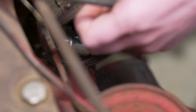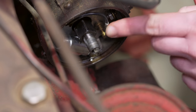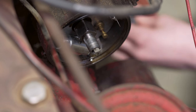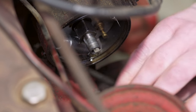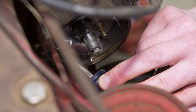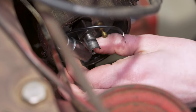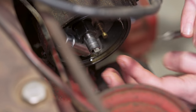The next piece to remove is the condenser. See how that wire wraps around there — that wire was held on the same tab as the points were, so you can just lift that off. Then there's a little strap that goes around the condenser and you're just going to use your screwdriver to pull that out. Mine has a regular screwdriver slot here and it had Phillips on the points. You need a stubby screwdriver to get inside there. Pull this screw all the way out and that'll loosen up the strap and the condenser will pull out — and that is as deep as we're going to go into the distributor in this video.